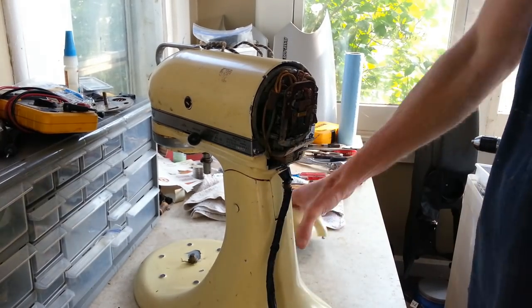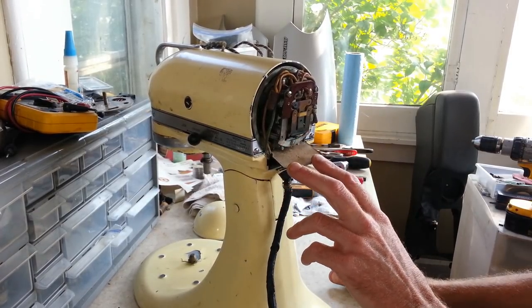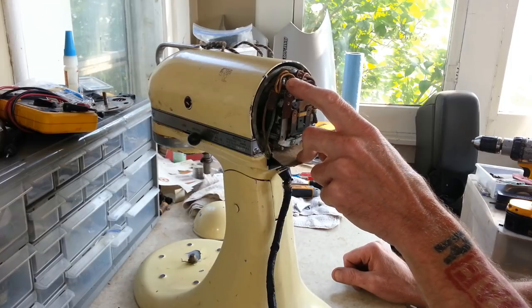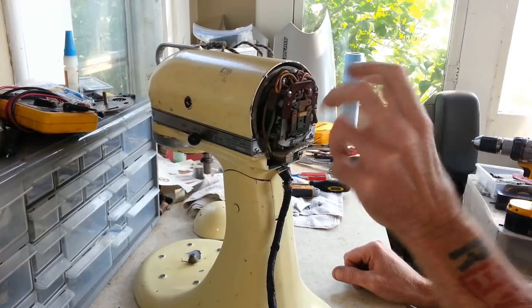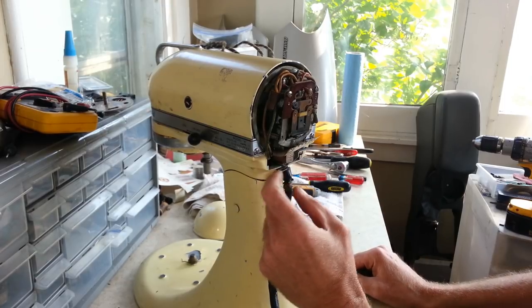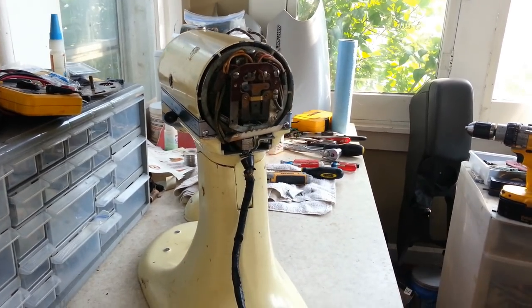It doesn't look that different than most of the KitchenAids, but I noticed the speed control is kind of flipped. It looks like the same identical speed control as on your other KitchenAids, except this part back here with the contacts is flipped. And it may be a little more heavy duty as well. And the switch is right back here. So if I can get you guys a shot of this,